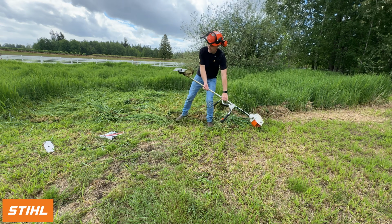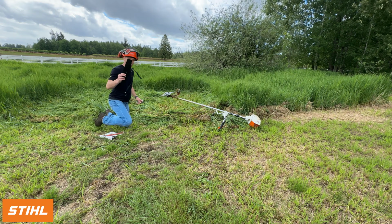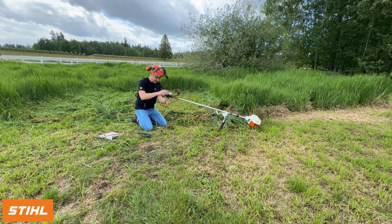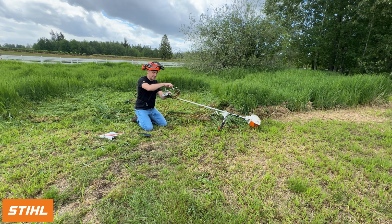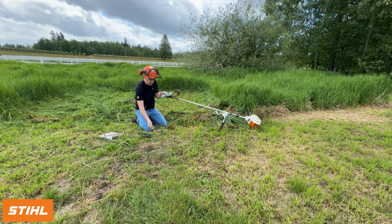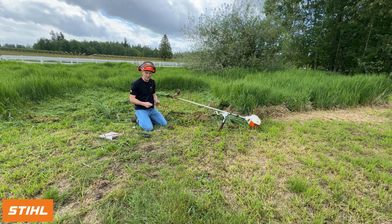Let's flip it over and let's go to the 14-inch flat. All right, so this is the widest blade of all of them. I'll hold this up to the grass cut here in just a second once I get it off. Locking pin in place. Again, reverse thread, so clockwise to loosen. Spin that nut off here just a second. Did you notice there was no debris flying when I did that? That is something unique about mini blades, is they don't really throw the stuff. I still recommend safety material. You'll never know what happens.